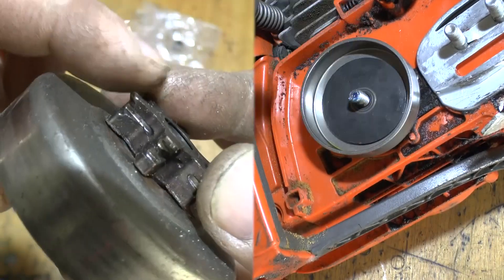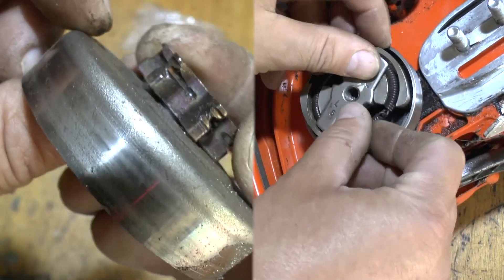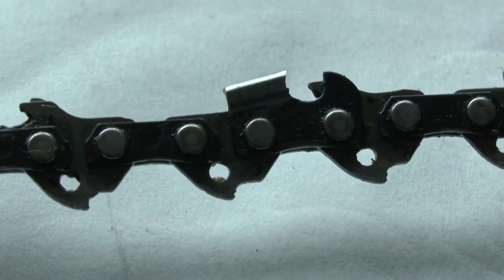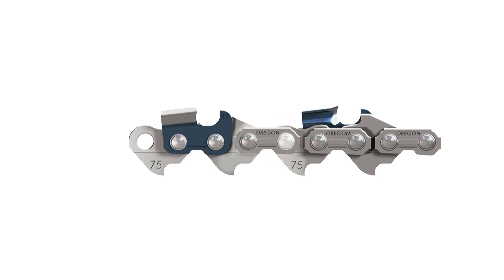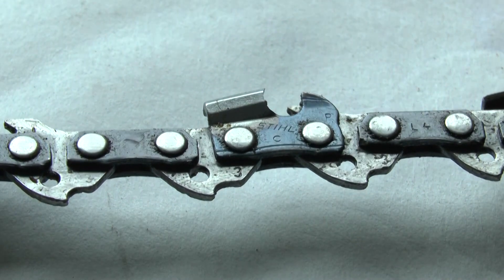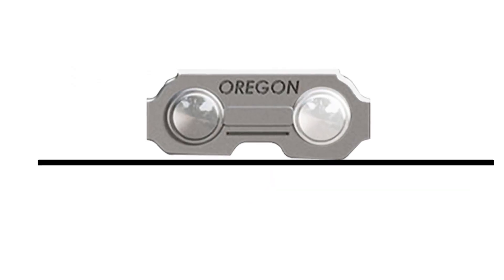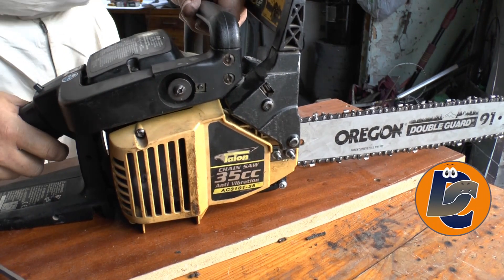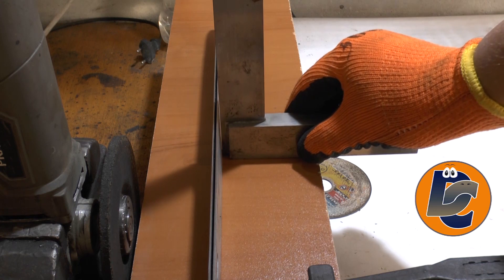If there are grooves on the sprocket, change the sprocket — otherwise the chain could break, bearings could crumble, and the sprocket welded to the clutch disc may fall off. Finally, even a new chain can break because of improperly installed connecting plates at the riveting point. Wherever you buy a new chain, inspect the connecting link — the rivet will be slightly larger or brighter. Check that the connection strips are correctly positioned; some chains have an arrow indicating direction. If there is no arrow, the correct orientation can be determined by the front support of the strip being bigger than the rear one. A wrongly placed connecting strip will be skewed, increasing load on the rivet until it fails. Keep an eye on the condition of your chainsaw's bar and chain, like and subscribe to the channel.